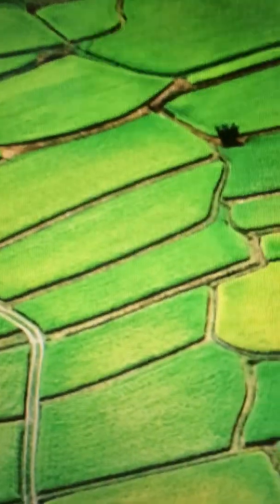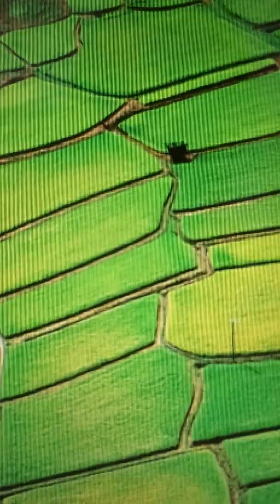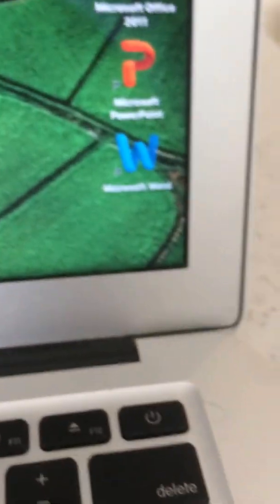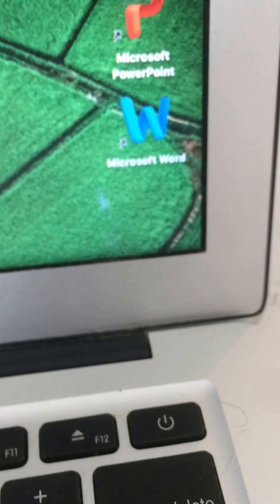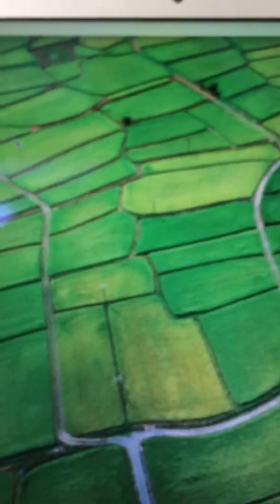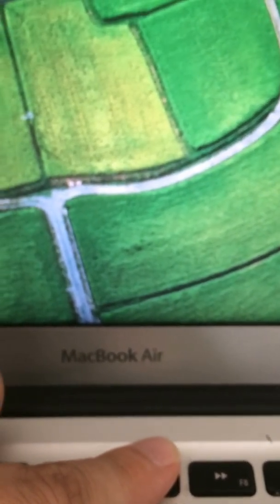This particular machine works okay. I use it for taking notes in class — nothing spectacular, none of my regular day-to-day business. I think this particular machine has had a spill on the power button. So if you are not holding down the F7 key, this machine gets a pop-up asking if you want to shut down your Mac, and it will come up every four seconds. For whatever reason, depressing the F7 key makes it think that that key is in operation.